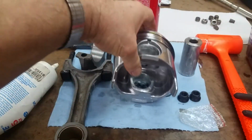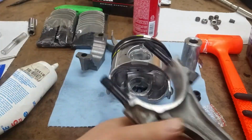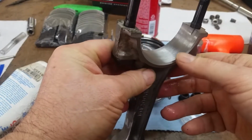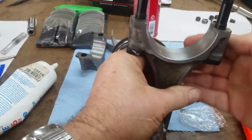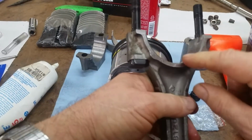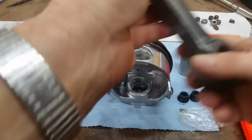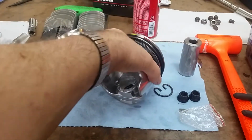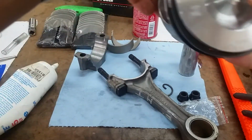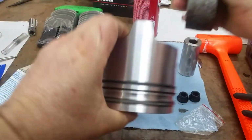Okay, now comes setup on these rods. Make sure you can see that. There's a chamfered side and what I call a smooth side. Smooth sides go together. Chamfer side goes against the crank pin. So this assembly, we're doing 1, 3, 5, and 7 right now. And the cam is going to go that direction, and this rod is going to go that direction.